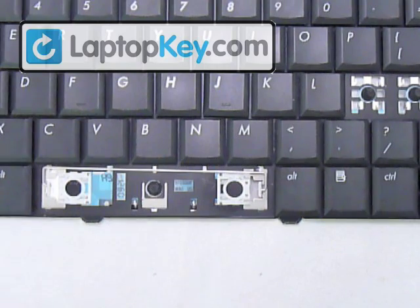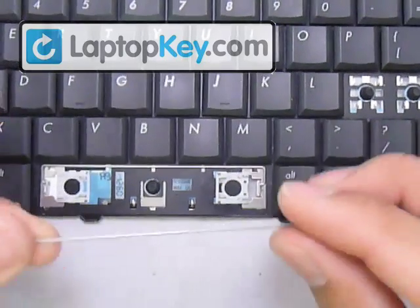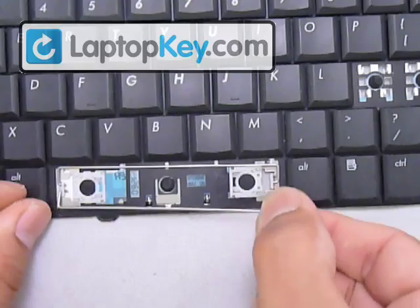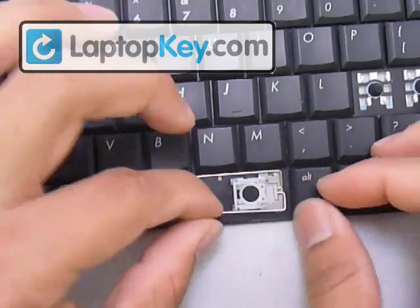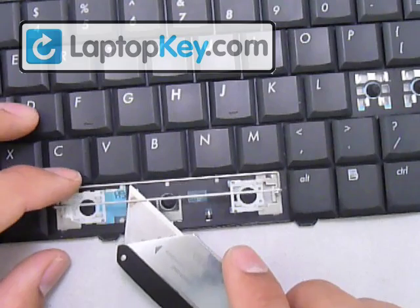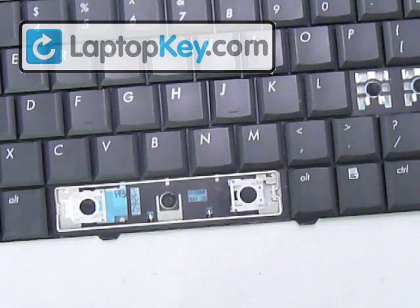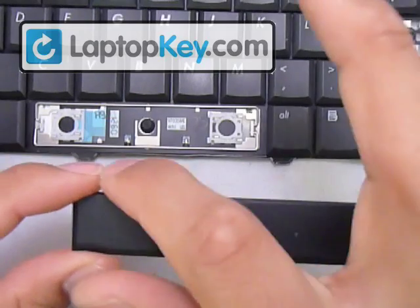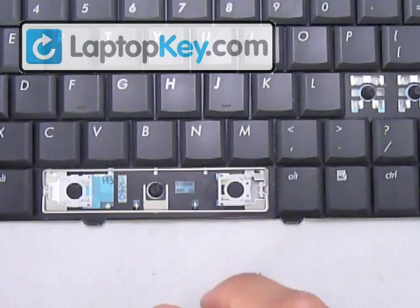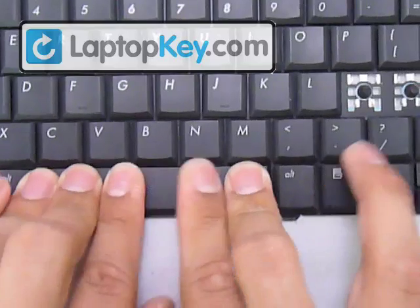For the spacebar, it's the same procedure as far as the hinges go, but it also has two wires. These wires go around and under the fittings to the very left and right. Position those wires downward — the bottom wire goes toward the bottom and the top one toward the top, so pretty much away from each other. Then determine the position for the keycap: at the top it's square and at the bottom it has an angle to it. After everything is in place — the rubber cup, the two hinges, and the two wires — put your keycap right in the center and push down evenly on the entire spacebar. And that's it.